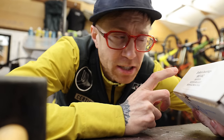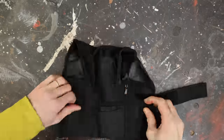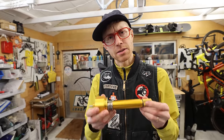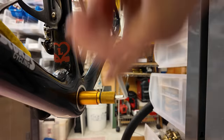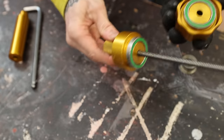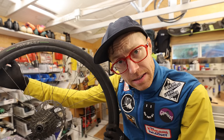If you're looking to do this at home, you'll need a special bottom bracket remover and installer press kit tool, which costs an additional $210. There are no instructions in the box, and I'm not a mechanic. But starting with the 30mm collet, inserting it into the bearing, then using the expander rod — it was astonishingly easy. Bottom bracket: check.